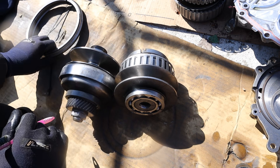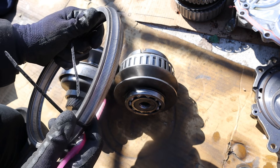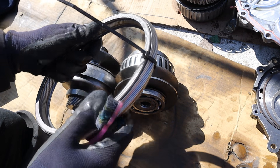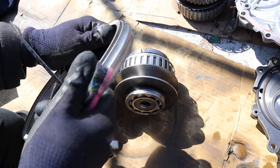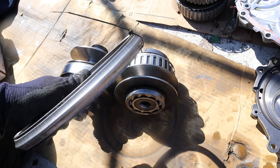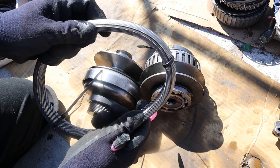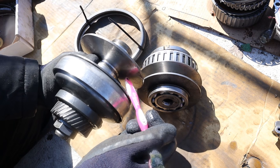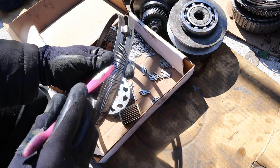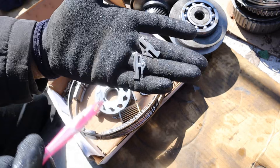Taking a look at how the variators and the belt work together, the belt itself is made up of hundreds of different pieces and it's got two steel bands that hold everything together. Remember that a CVT belt is a push belt — unlike a pull belt like an alternator, it's not pulling the other pulley, it's actually pushing it, which means all of these pieces are being compressed together in order to transmit rotational force. Looking at that variator, it's got a cone angle of about 22 degrees and the belt also has a cone angle of about 22 degrees, so they always mesh together no matter where the belt is riding on the surface.